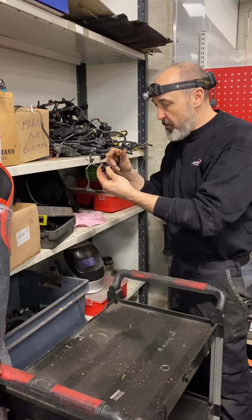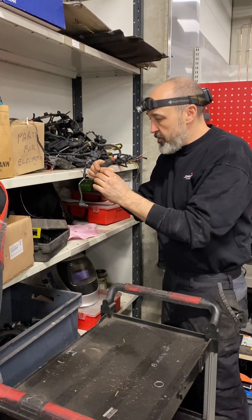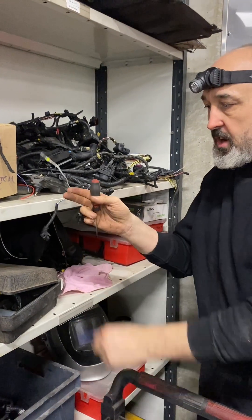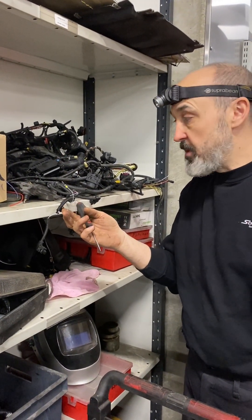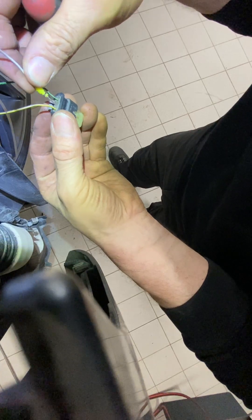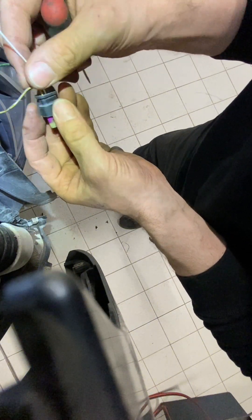You probably wonder why I have this collection of connectors in my corner - connectors are really expensive and a pain to find the right one. I visually identify it and not only do I have a new connector but I also have a brand new sealing plug as well - pretty much the same size. All I need to do is cut it off and I've got a genuine wiring connector. I pull the locking tab off, get our dodgy signal wire, pull it out, chuck it away, get our new one, get the orientation correct - and you've killed two birds with one stone. Click - that click always makes me happy. Now we've got a lovely sealed end.